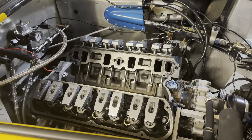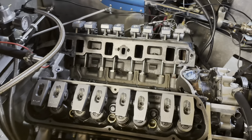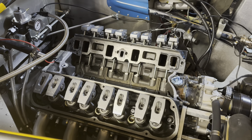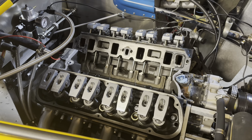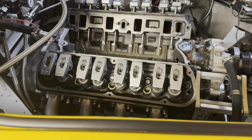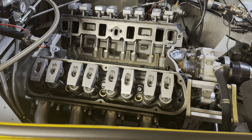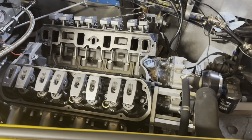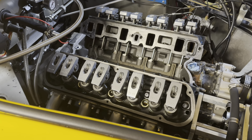Making progress. I had to pull the valve covers off in order to get the intake out because it's a tight fit with these P heads and that lip they have up there. It's very snug, and with the rocker covers going over that I couldn't get it out that way. So I pulled those out and was able to pry it loose. All that stuff is off the top. Next on the list, I've got to get the headers unbolted from the heads, and then it'll be pulling the rockers, getting the head bolts out, and pulling the heads off the car. I also have to pull this accessory bracketry off of this side — the other side has nothing. So next on the list is to get the headers unbolted and go from there.